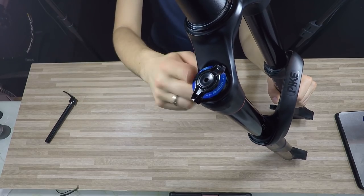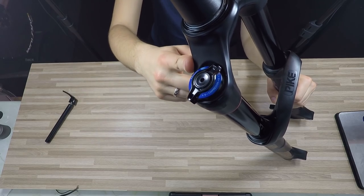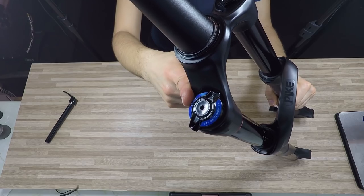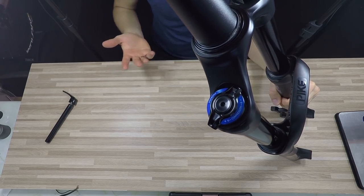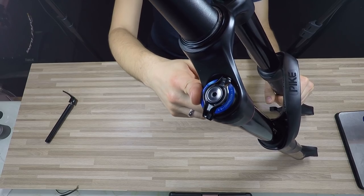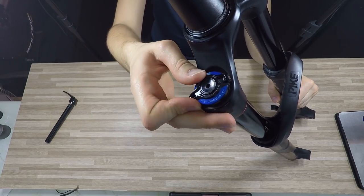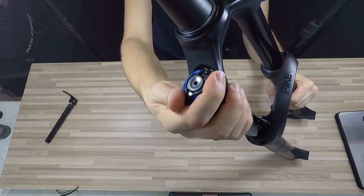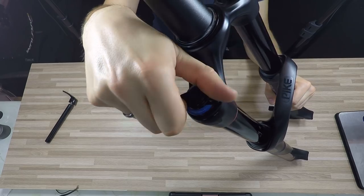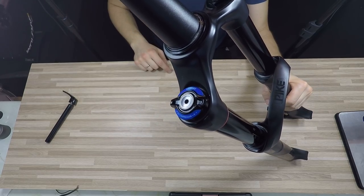And this was in the description of the RC model. So that's something I don't fully understand. And also they say it is the low speed compression adjustment. I would not say just low speed because it works very well for the high speed bumps. And I was actually thinking about those high speed hits when setting up this compression. Actually, I would use the maximum one and the sag below 20%.